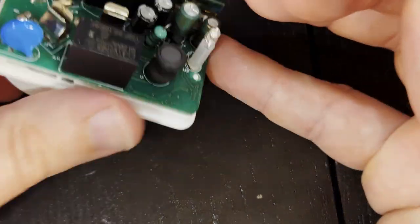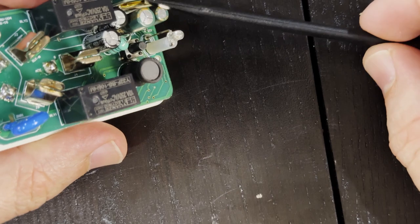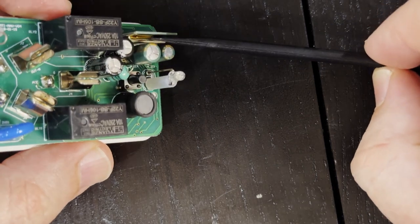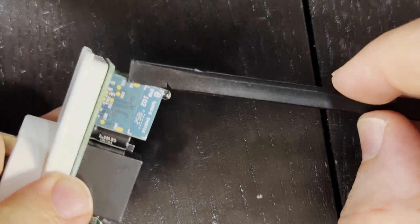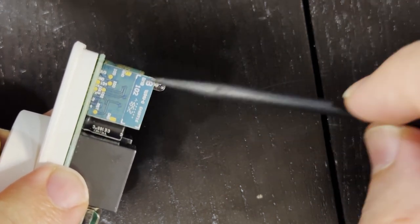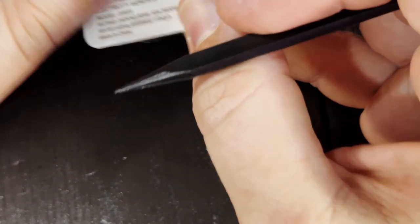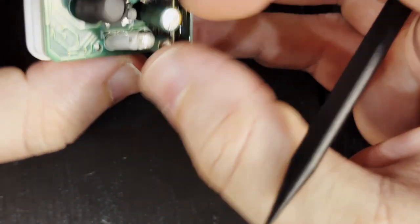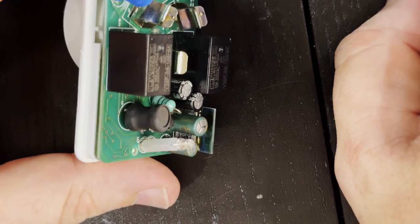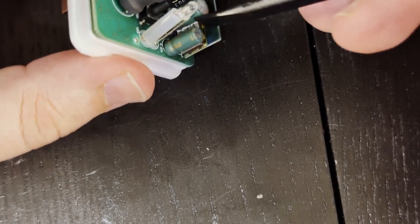This cap has a slightly bulgy top and when I press on it — it's quite loose. It's right next to the button and leads into the controller here. It's a little hard to make out but this is a TYWE2S controller — an ESP8266-based module — with solder pads on the back where you could reasonably probe the pins and flash Tasmota onto one of these units. I'll see if I can slide the back case off. It looks like the pins might be molded in, so I may not be able to get the bottom off. I'll grab some pliers and see if I can get this cap out.